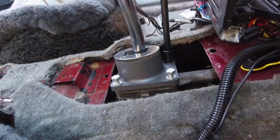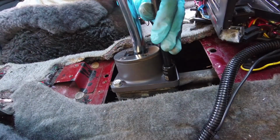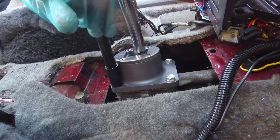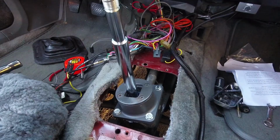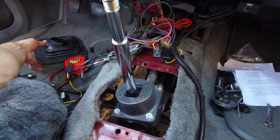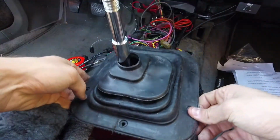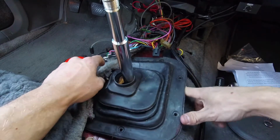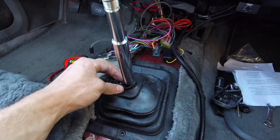With the bolts installed finger tight, we used a socket and an extension to snug them down by hand, before torquing them to the recommended spec, per COSMO Racing, of 8 to 10 foot-pounds. You might notice that one of the bolts is different in this shot, and that's because I had some issues with stripped threads and had to do some repair. It's unlikely this was an issue with the supplied bolts, as the bolt had no apparent damage on it, and I tried swapping it into a different hole with no issues.